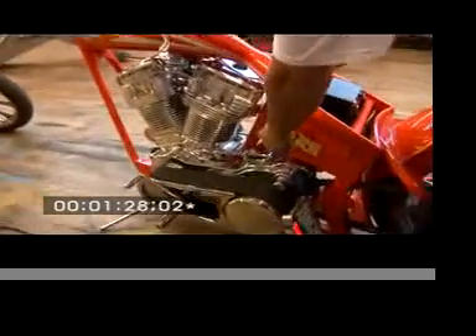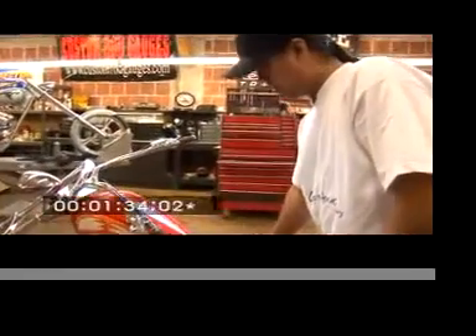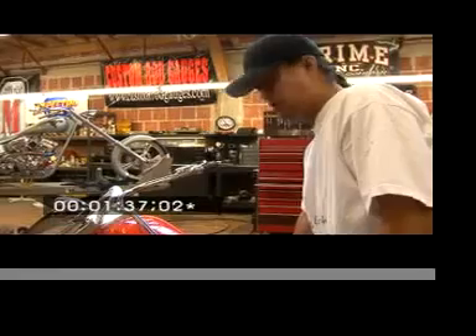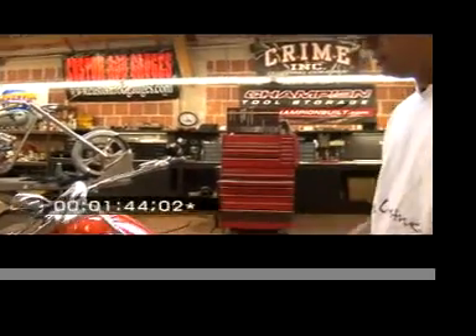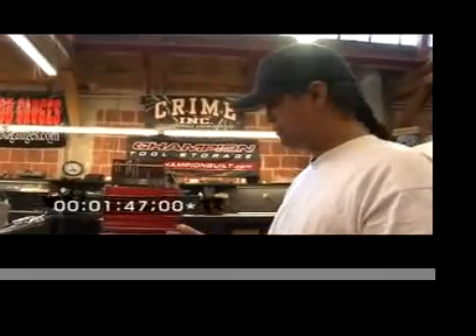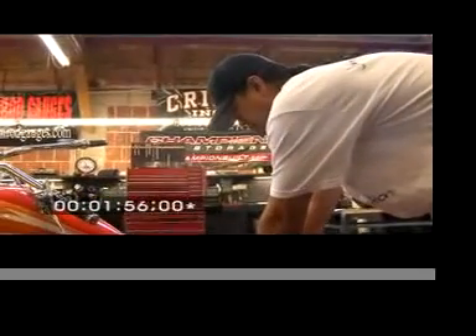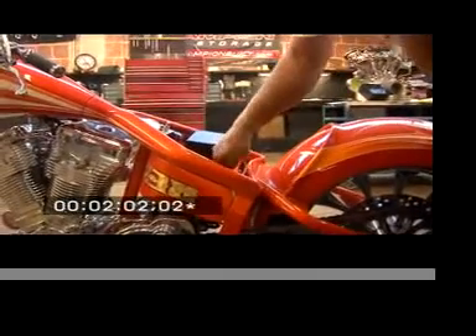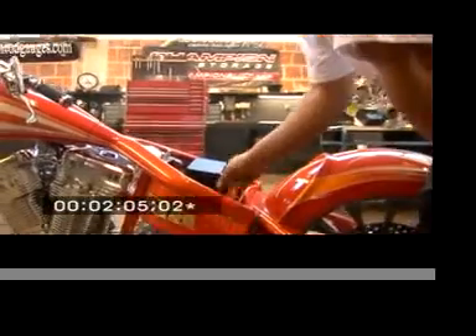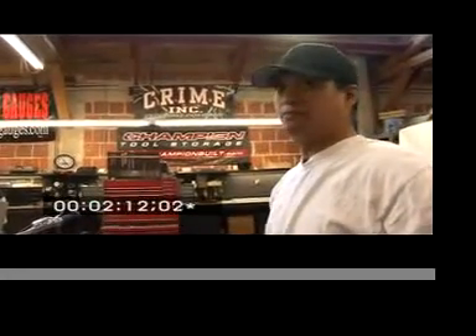As you can see, there's a little smoke — smoke from the starter. The starter is overheating right now, which is pretty crazy. That was just probably the worst test you can do to any starting system. You can see the smoke coming off the starter because it got so hot. But the actual cables are not even close to being hot, so the amperage from the battery is still pretty low. On a normal battery, the cables would be melted by now. You'd probably get maybe six turns. This thing has probably turned for about a good minute and it had more left in it.